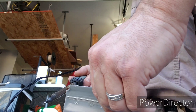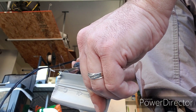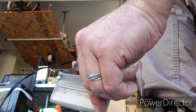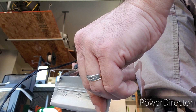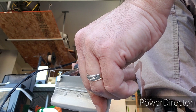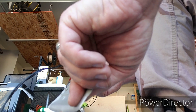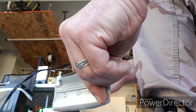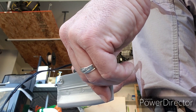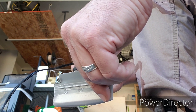Before I get under the truck, I just wanted to show you real fast that the soldering iron melts right into it, doesn't burn it, makes it nice and sticky so that you can combine it with the fuel tank plastic that's melted and you get a good solid amount of material to seal up that puncture.